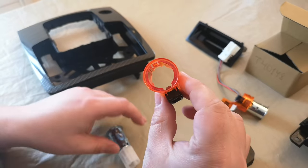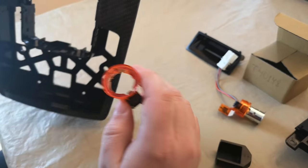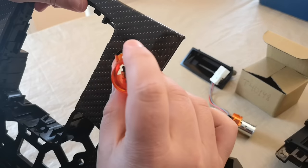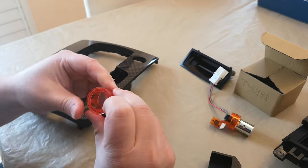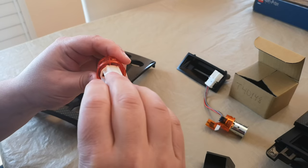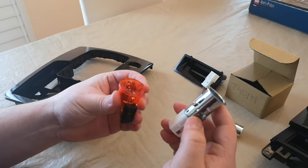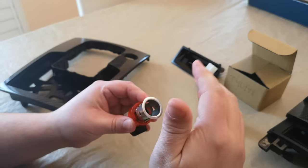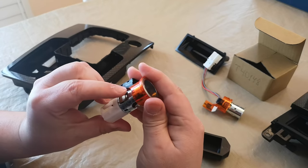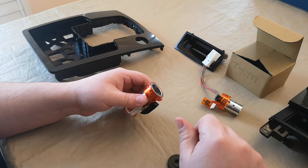Also keep in mind that there are guidelines on how to insert — there is a line here which corresponds to the line here, so there is no other way to insert the pin and the actual cigarette lighter. The same thing applies to the internal pins and internal rails — there is only one way to insert it. You first insert this part, which is the lighted one, then insert this one until the end. That's it — that's how it looks originally, with two pins on the sides keeping it in place. Thanks for watching, subscribe to my channel, until next time.